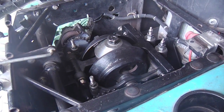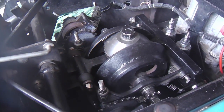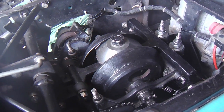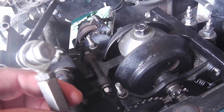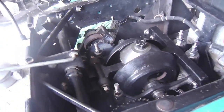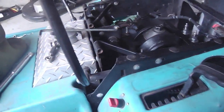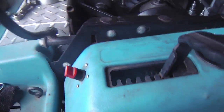Okay, now with the unit in, we want those cradles to retain their neutral position. That is, the disc cups not to touch up or down. You can hear that tapping up or down. And since we've connected the ball joint coupling tie rod ends, that transmits whatever weight is on these levers, and we can see that it is not neutral. There is a slot right in there.